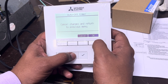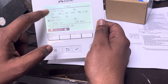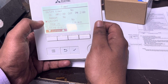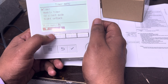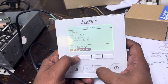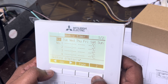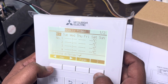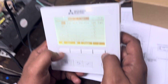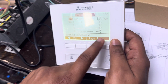If you need it again the next day, you must come back and set it to Yes again. If you don't want it, go back. I selected No for both these settings. The third and most important timer is the Weekly Timer, which most customers need. Enter the Weekly Timer — it will ask which day you want to configure. There are two weekly format slots available, so you can have one schedule for one week and a different schedule for the next.